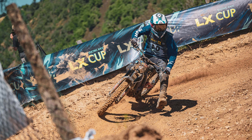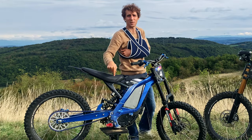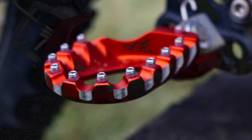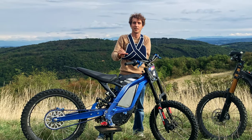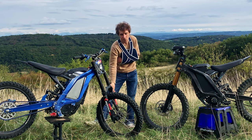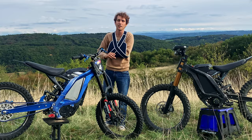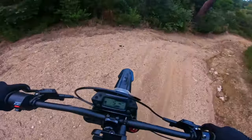This is the one I use riding on MX track even though I'm not tall. Then you will want to change your pegs, because the stock pads are super narrow — they don't have spikes. If it's wet, you will definitely have a really hard time staying on the bike. You can also upgrade your front disc to a bigger rotor and change the brake pads; without even changing your brakes, this will definitely improve the bike and the feel of your stock brakes.